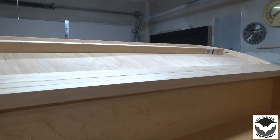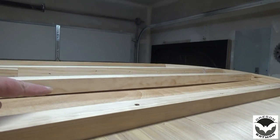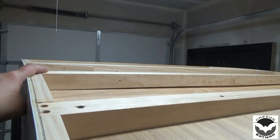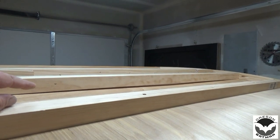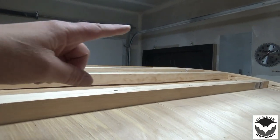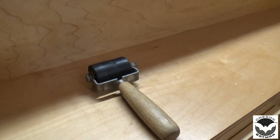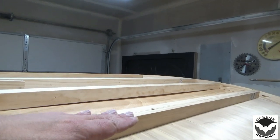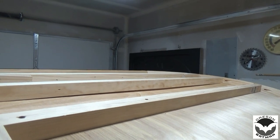We've tackled the hills. Let's take care of the valleys. So I've got this huge gap under here. My spar is prepped. It's pre-drilled. So now we're going to pull that up. We're going to apply contact cement here. Let it cure out. Then we'll set everything in place. Fasten it down. Go on the inside. And take our roller and roll that ceiling out. And that should take that little valley out of there, right to that wood. Let's do it.